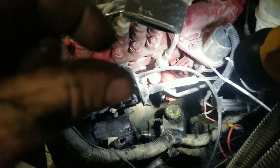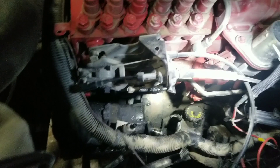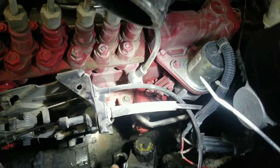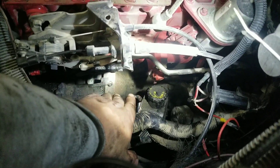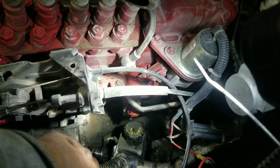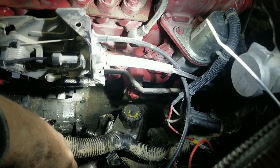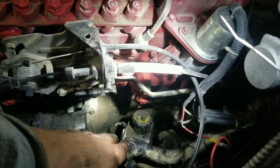If you have a stock oil pressure sensor or gauge, it's going to be right in there. When you slide this guy back, be certain you don't snap that sensor off — it's pretty lengthy, with the threaded part and a big bulb behind it. That sensor is stabbed into the block right in here, and if you're really rough about it you'll break it off when you pull the power steering pump or vacuum pump — that is a major no-good situation. Be very careful; it sticks out about three inches and it's a bugger to work around.